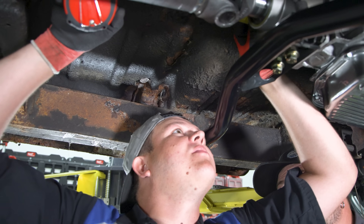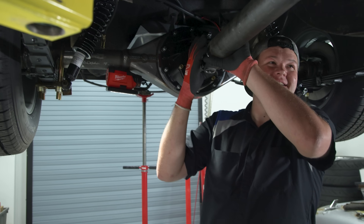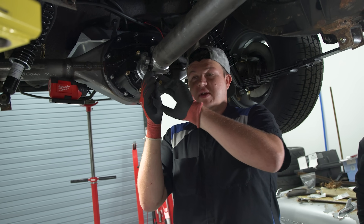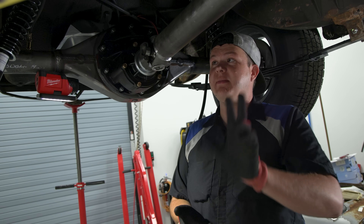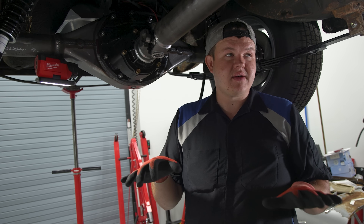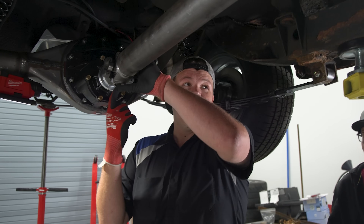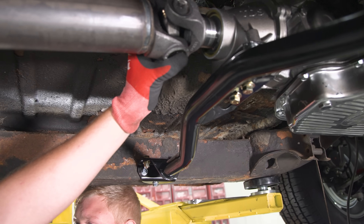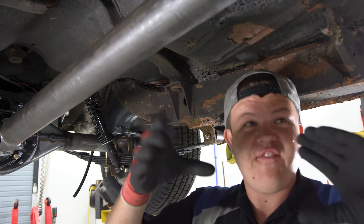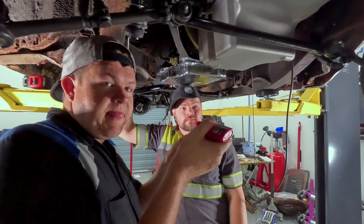That's right at seven eighths — that's perfect. It fits. We have it clocked. We're going to take it to the driveline shop. What clocking is — you want to make sure that your U-joint caps are in the exact same orientation, otherwise they fight against each other. We've got the measurements for them and they can clock it a little better if needed.